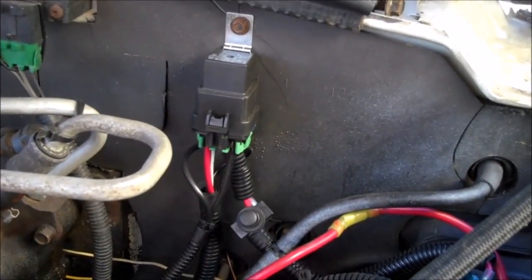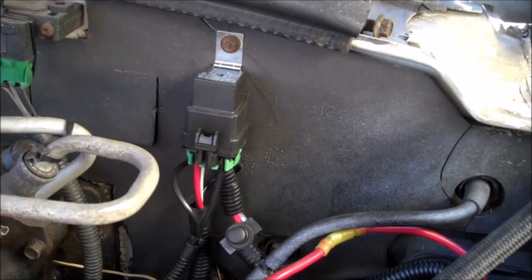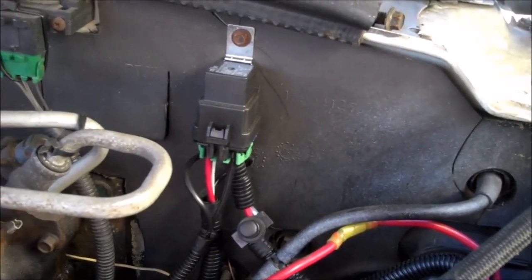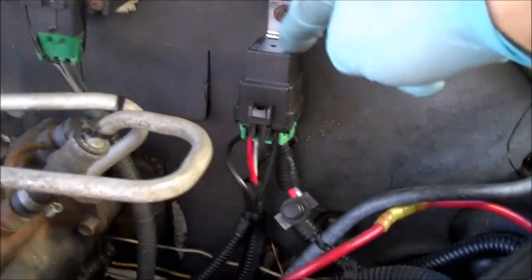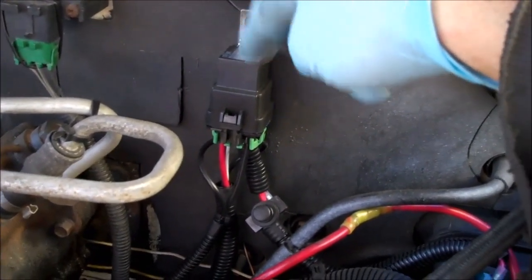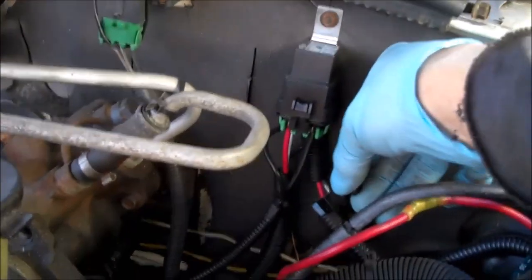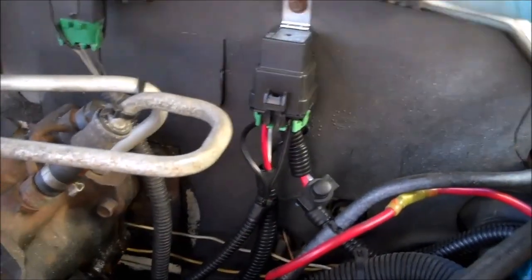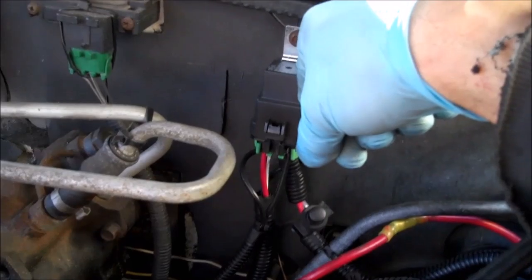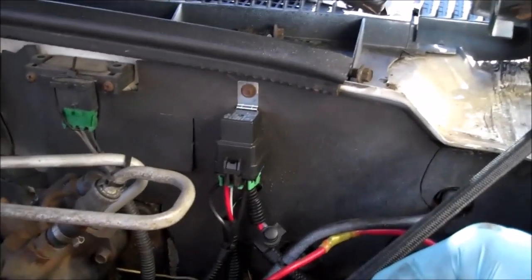This will keep it nice and healthy. The aftermarket also took care of the wiring problem for that oil pressure switch. Instead of running the load of the electrical through the pressure switch — which is way too weak to handle even the stock pump — the aftermarket makes a small relay that you can buy to power the fuel pump directly from the battery. This one I bought from Leroy Diesel, but Kennedy Diesel makes them too. It's real handy — this one actually comes with a manual button so even when the truck's off, I can push the button to start the pump just to bleed my lines if I'm changing a fuel filter. It's a handy deal to have, and it's pretty cheap aftermarket stuff that makes your truck bulletproof.